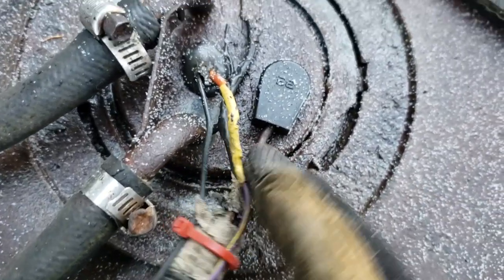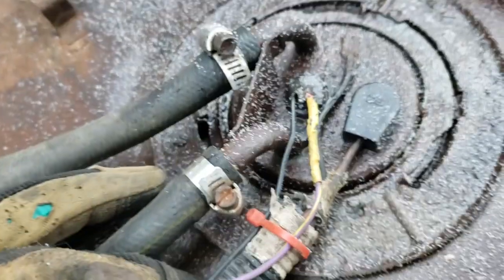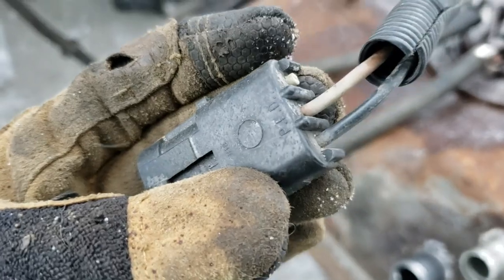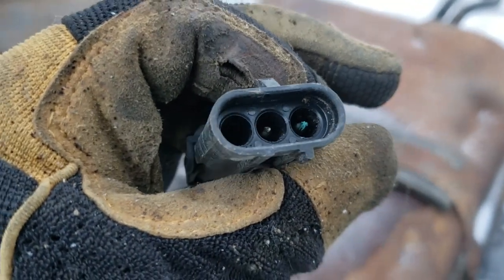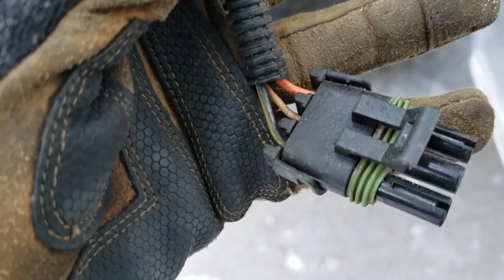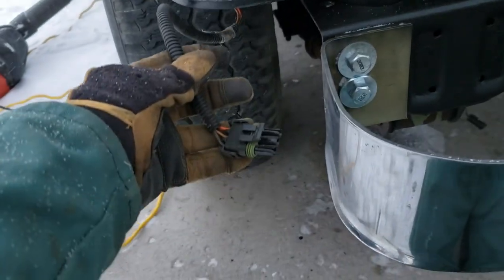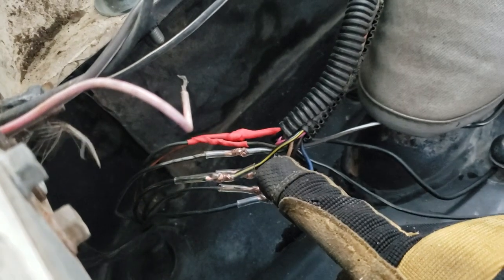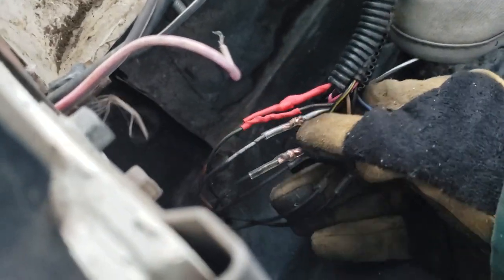There's also a wire that goes here and another that goes here - I'm guessing this is ground. Both of those brown and black big wires come out into this connector right there. There's another wire that's cut, and if you look on the inside there's no prong for it. On the Jeep side where that plugs in, there's a black with yellow stripe, a brown or tan, and then an orange - this must be the three wires people keep talking about. It goes up into this loom which goes up into the Jeep. So we have black with yellow stripe, that tan color, and I'm not seeing an orange.